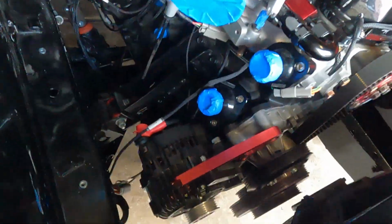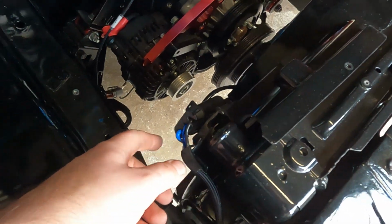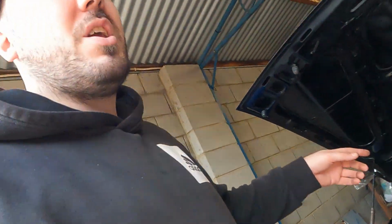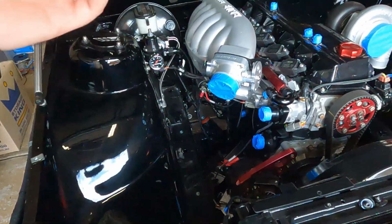Have a look at this. FG Falcon thermo. We're utilizing the low speed, high speed. It is beautiful. This thing, inrush current is like 50 amps or something, and setting it up with the low speed, high speed, they come on so smooth. And I think the FG total amperage on high, once it's already kick started, was only like 20 amps, 22 amps. So we've got the soft start, so the low speed will kick in, and then the high speed will kick in. Turned out mint.